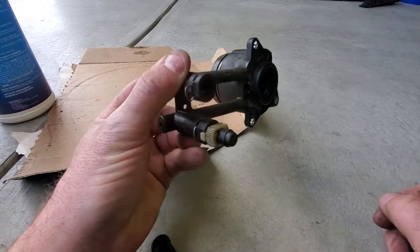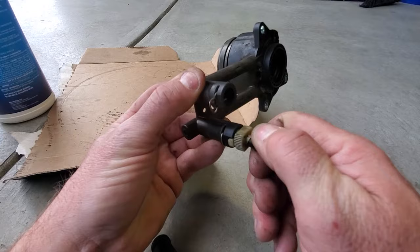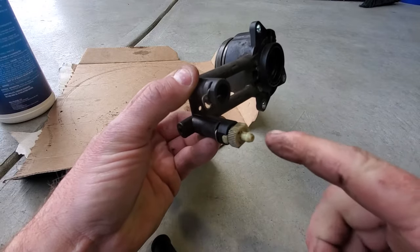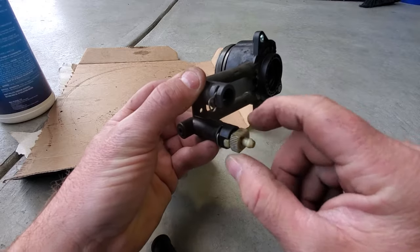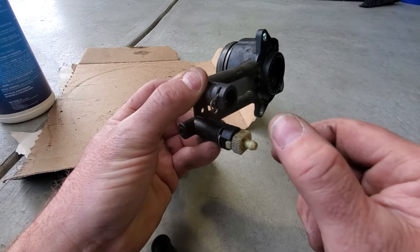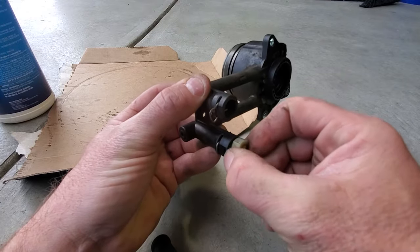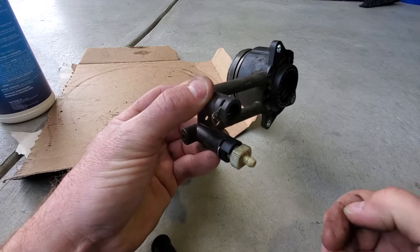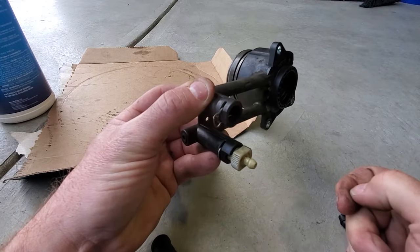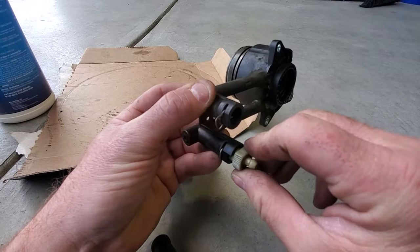And so this, you'll have a dust cap on here, which you'll want to remove. Then we'll go ahead and stick on our tube from our Mighty Vac. And then this means it's closed when it's all the way up. And then if you turn it counterclockwise all the way down until it stops, that means the valve's open. So we can go ahead and start pumping brake fluid in. And then once we pump in all 4 ounces, we'll go ahead and close this.